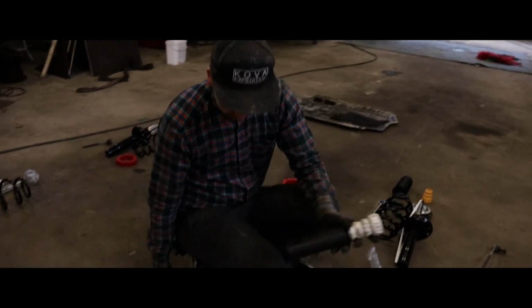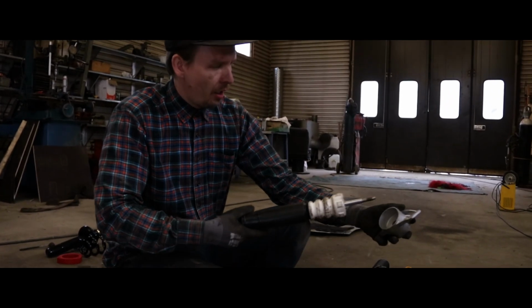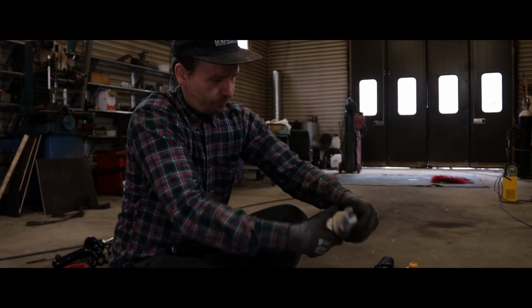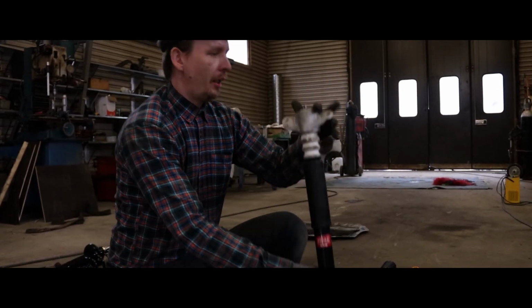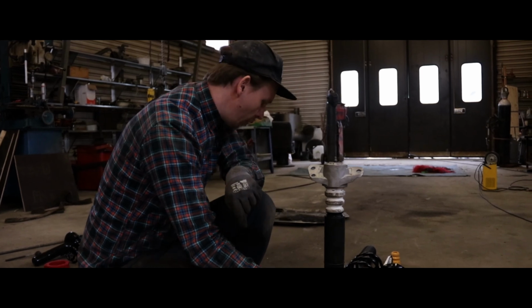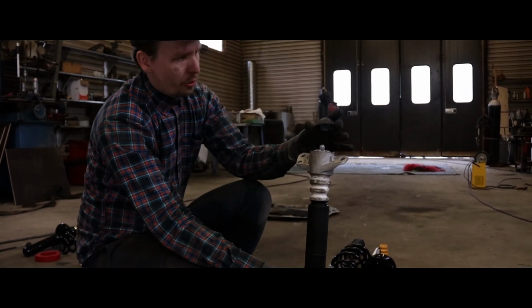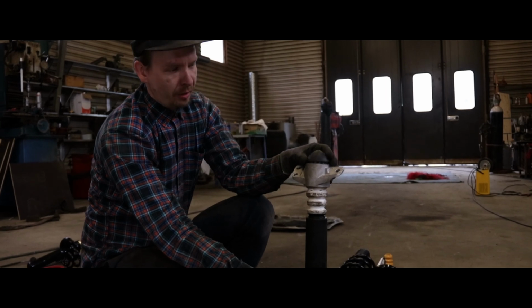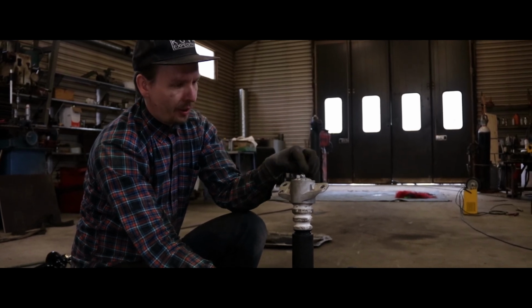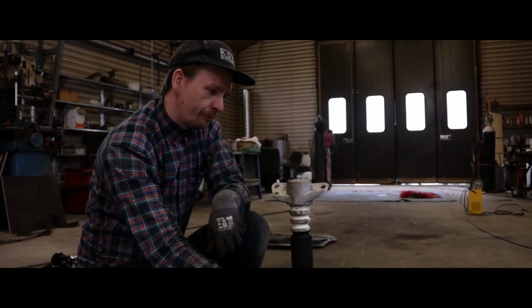Like so. So now it does not move freely, and this bump stop mounts directly on the upper bracket, like so, and then the nut goes over here like this, and on top of all that goes this plastic hat, so it prevents dirt and other stuff from getting directly onto the nut and the thread and the whole upper side.